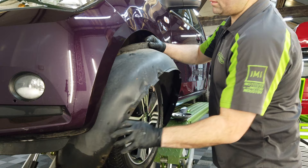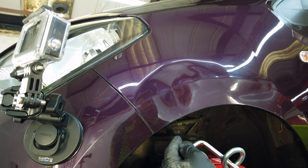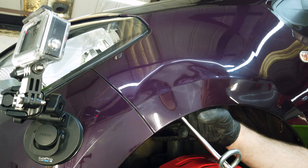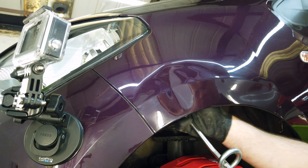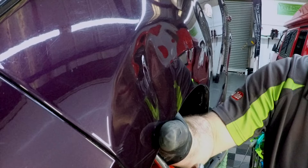So I'm going to start with repairing the largest area first. Getting my leverage device in place, I'm using the moose knuckle. I'm using my screw-on tip bar with a large rubber ball, placing a small amount of pressure on the rear of the damage right where the body line is. Going to use a heat gun and get this area really warm — this is going to give the panel a lot more flexibility without any chance of the paintwork cracking. You'll notice that my thumb is on the edge of the panel to stop the wing lip from blowing out while I'm giving the dent some strong pushes.